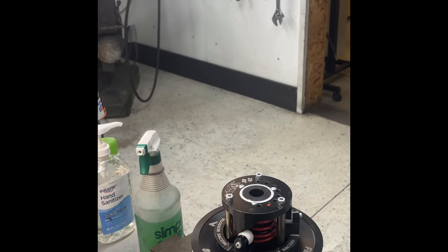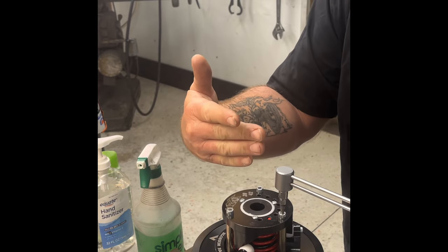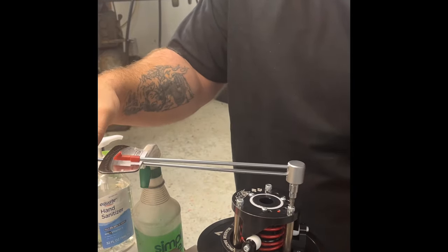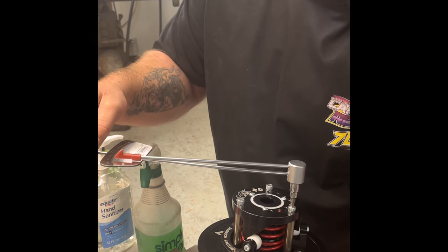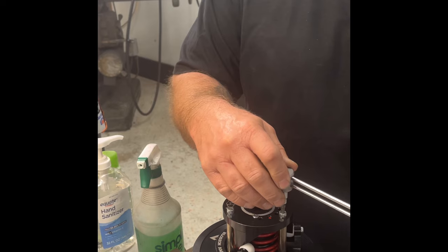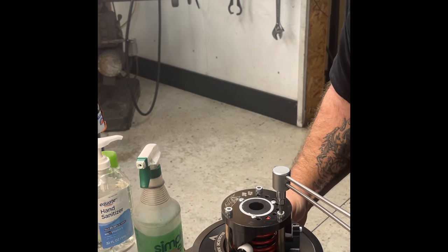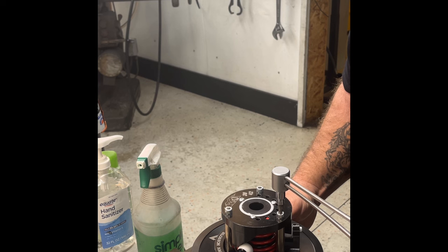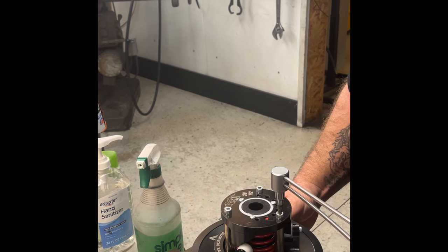Just pull up to your secondary, put your tool right in there. I usually do it the same every time — I'll take the tool and make it stick out straight away. When you're turning this, right when you see the helix starting to turn, that's when you want to take your reading. Going straight away, I'm getting about 55-inch-pounds.